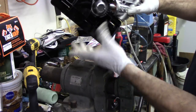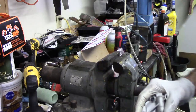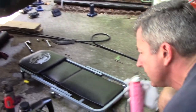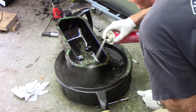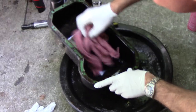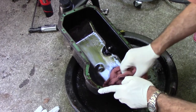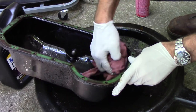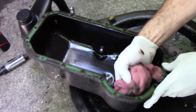I'm happy with that — if the thing's not going anywhere, we'll clean it up and put it in the car. Got the pump bolted in the car. I'm just going to clean out the pan real quick. I'm not even going to mess with this gasket — it came off fine, so I'm just going to wipe it off and it's going back on just like it is. I'll either return the other one or save it for another car. It's pretty clean, just a little bit of sludge. We'll get this wiped out and get it back on the car.